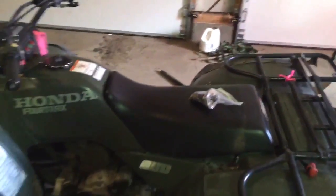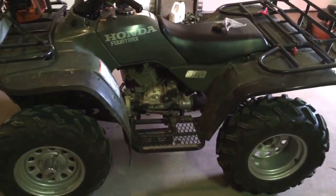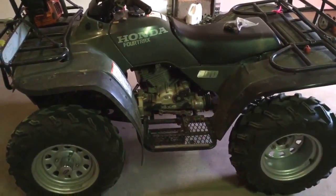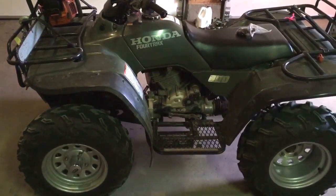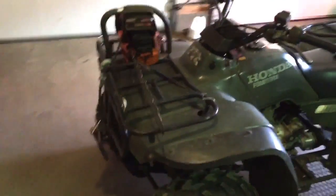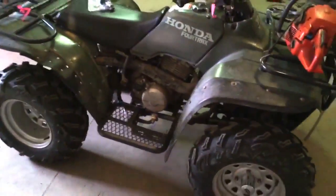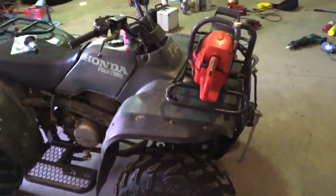So for you guys that don't know what I'm talking about when I say Big Red camshaft — this is a 94 model 300, so it's got a bit of a milder cam than the original 300 had. The 88s for sure had a bit more aggressive camshaft in them, and I'm thinking the 89, 90s, and 91s also had it, although some guys seem to like to argue with me. I don't know for sure to be honest, but when I go on Partzilla and look up the part numbers, the 88 to 91 have all the same part number for the camshaft, and 92 and on are different.